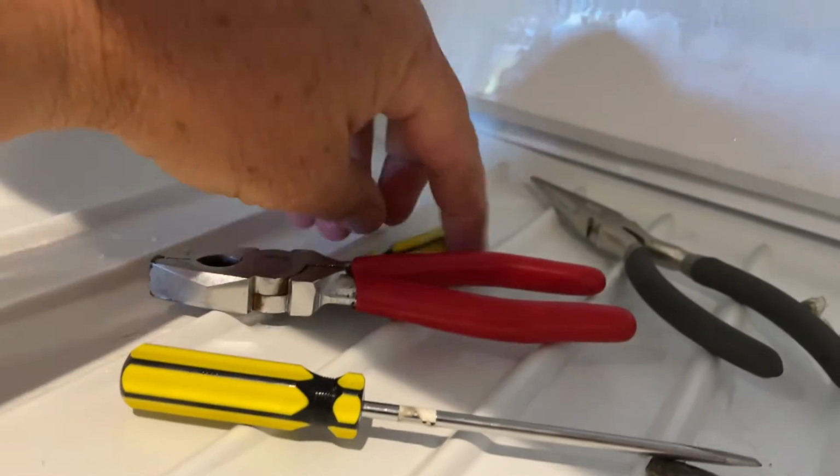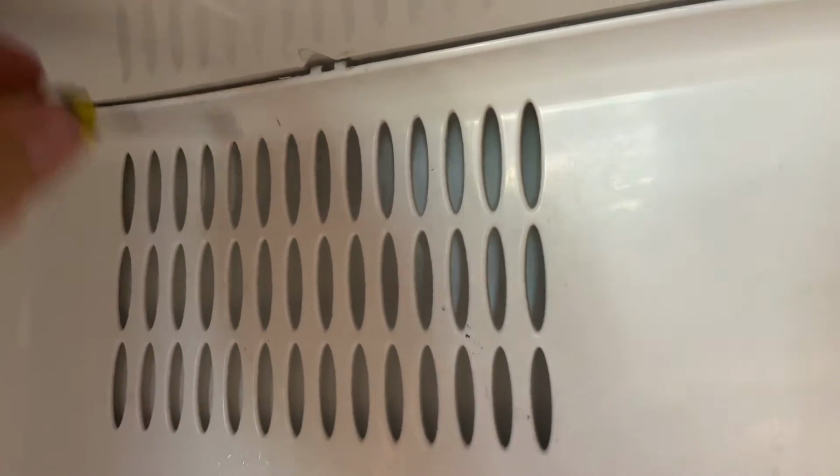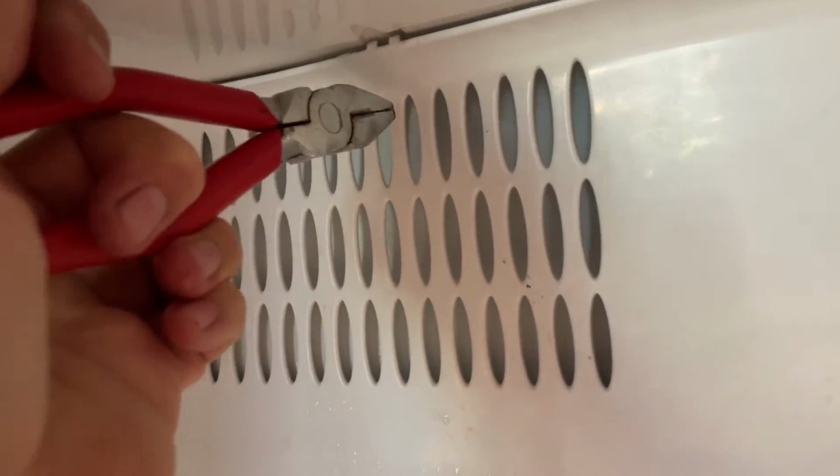It is possible. Mind you, you've got to be absolutely brutal to do it. You'll see you've got these two little clips up the top, here and here. And what I did, I got a couple of little screwdrivers here to get that started. You get the clip down and then another screwdriver in beside it to open it up. And then a pair of pliers, and I actually grabbed hold of that top lip and pulled it forward. And I'm talking pulled it really quite hard. It was all jammed in under these edges. And then this panel here came forward.